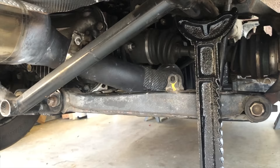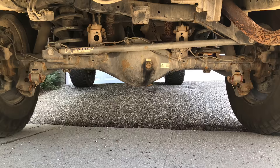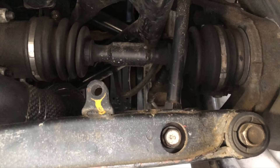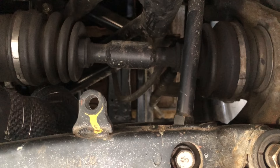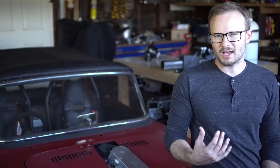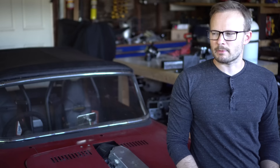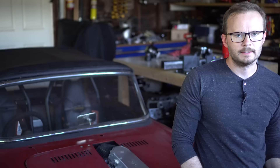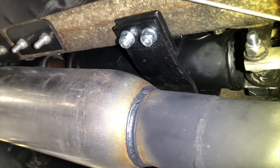If you can manage the fabrication to adapt uprights or all-new suspension from a donor car, it might be in your best interest to just do that, especially if you're going with a horsepower upgrade as big as this. There are some easier solutions, like a solid axle — a Ford 9-inch or something like that — get it adjusted to the length you need, throw it under the back with some springs, and you're good to go. I had to shorten the half shafts because this car is so narrow that those half shafts were way too long. I did it myself by just cutting them to length and welding on a couple of sleeves — be sure to drill some holes to plug weld. Any decent drive shaft shop could do this for you. I should note that the limited slip differential from the BMW did not work super well in terms of limiting slip — probably because you can't just take the differential out of a car that's three times as heavy with twice the horsepower and expect it to work. I ended up getting the angles recut to the most aggressive angle I could, and now it works out really well. I highly recommend a drive shaft loop if you're doing crazy stuff like this, and throw one in too if you have a two-piece drive shaft like me.